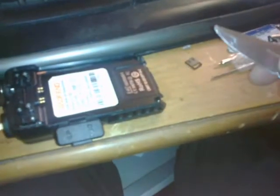I used a small knife to get underneath the bottom one here — lift it quite a bit because the plastic here is really quite wide, and straight underneath the plastic is the board. You don't want to be putting a knife or screwdriver on that and snapping it. Once you've got the back up, the circuit board is clear.